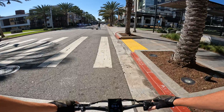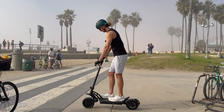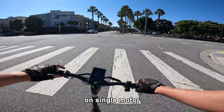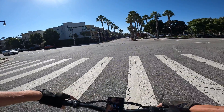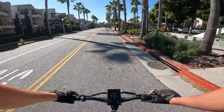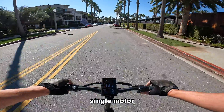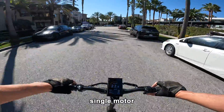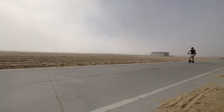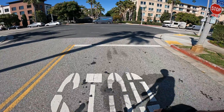The very first thing I'm really noticing about this scooter is the handlebar height is really pretty low. I am 6'5", so I'm a little taller than average. But power delivery is smooth — it is 1,500 watts peak. Regen brake is really strong. On PAS1 full throttle gives about 1,000 watts and brings us up to about 12.6 miles an hour. Bumping to PAS2 hits us with 1,400 watts, bringing us up to 23 miles an hour. The regen kicks in before you actually use the friction pads.